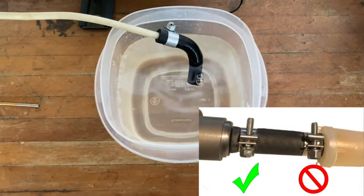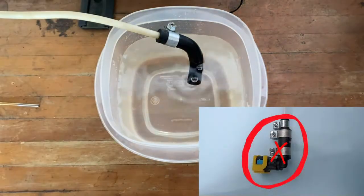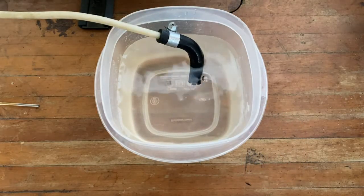The fuel clamps should be tight enough that the tabs are touching. Don't forget to look at the connection at the fuel tank — in some cases, a factory takeoff port is used, and if the proper adapters are not used, this can cause air to be pulled into the fuel system.